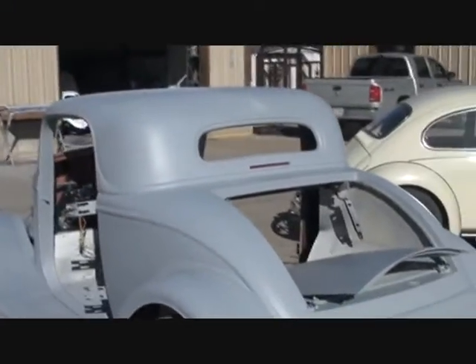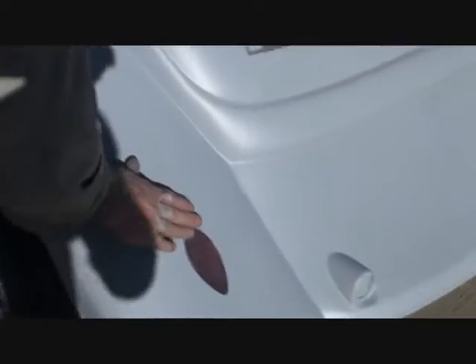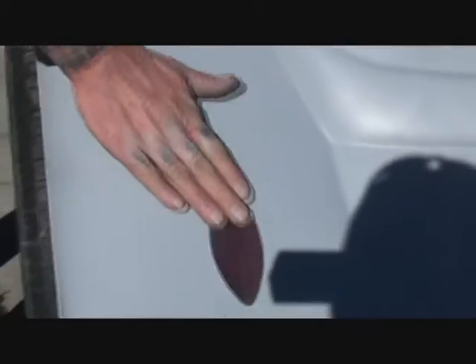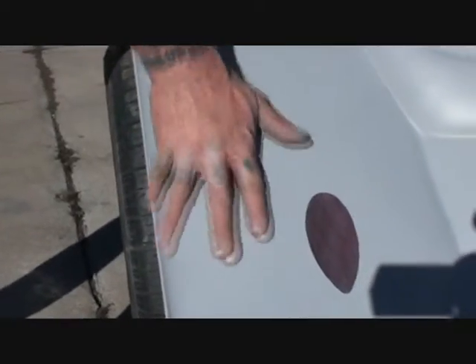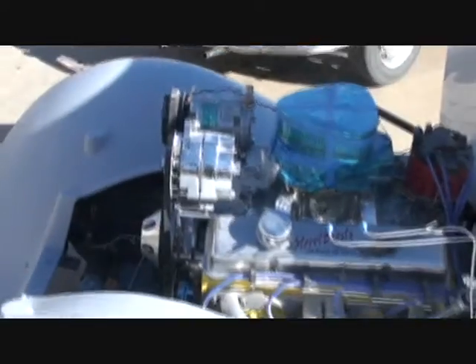As you can see, we got our coupe in primer. We also got our LEDs looking good — you do want to tape those off when you don't want to put primer on them. This is a two-part primer, it's very thick. Our coupe's looking really good. We got all our stress cracks fixed, got the imperfections from the factory mold fixed, and this thing's ready to wire and get running. Our next step is to hang all the doors and the deck lid back on it.